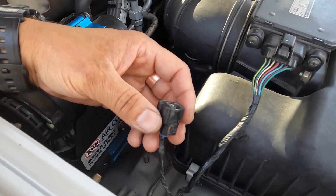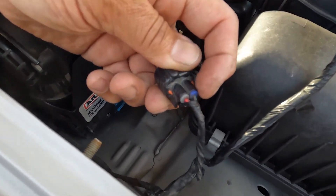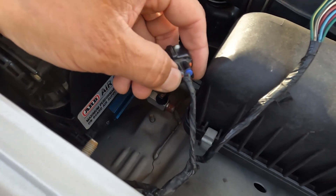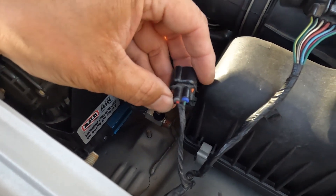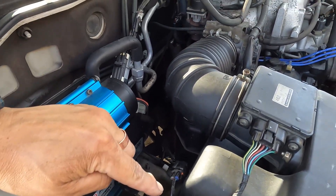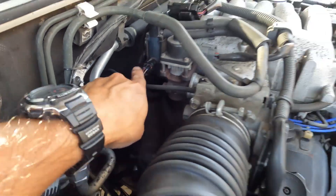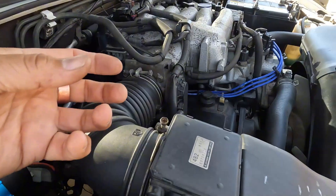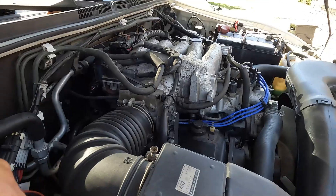The connector has a green wire with a red stripe, and it has a red wire. This red wire has power when you turn the key on. All the solenoids and actuators in the system have that red wire — it's the output from the MFI relay. Here's a red wire on the purge solenoid; all the injectors have that red wire too. Basically, everything activated by the computer uses power from the MFI relay.